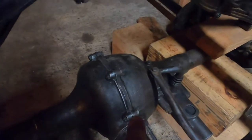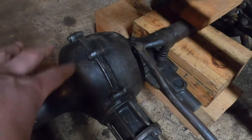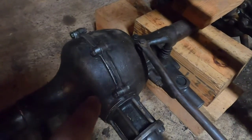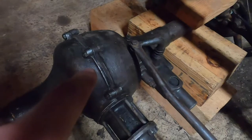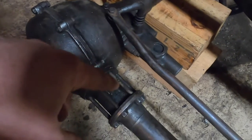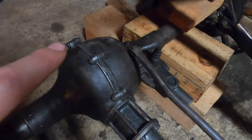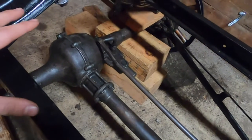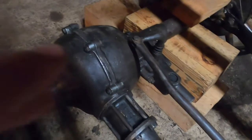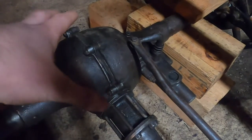If you have any problems with the rear axle, it is highly recommended to go through and double-check everything. If something breaks in there, it can be a pretty big safety issue — your wheels can lock up, you can break the drive shaft, and because the only primary brake is a transmission brake, anything breaking in the drive assembly leaves you without it. You'd have to rely on your emergency brake, so it's a serious safety hazard.